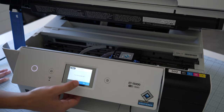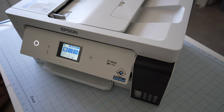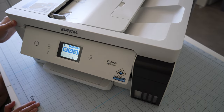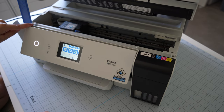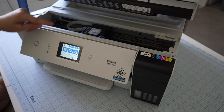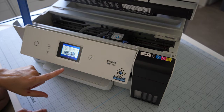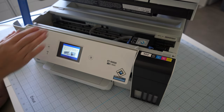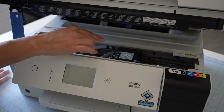Let's see what happens if I turn it off and on again. After moving it manually, I powered the printer back on — the error message was gone and the print head was still moving, so we didn't break it. One way to avoid pushing it manually is to open up your lid, watch the carriage, and then force-unplug it when it's more central so you're not working in the corner. I'm not sure that's the best move, but I do like having my print head more in the center. Grab the little white piece and move it out of the way for better visibility.